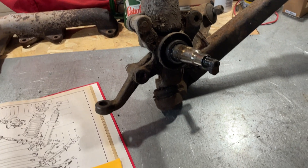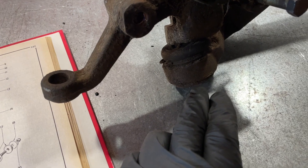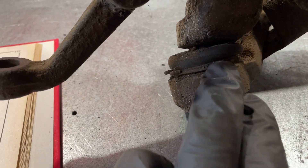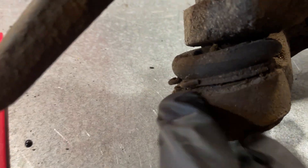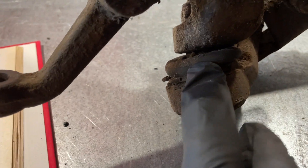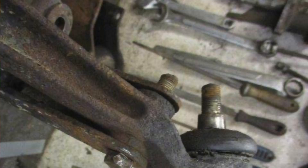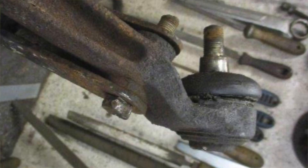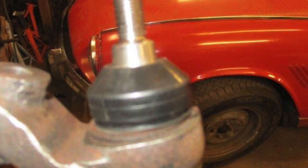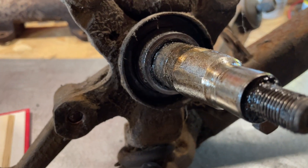The issue with ours was actually down at the bottom. Looking at the ball joint assembly — this example isn't too bad; you can see it moves around on a ball joint. Ours was leaking quite a lot. It's held by a little circlip round on top of the rubber, with packed grease inside. We had quite a bit of leaking grease. So whilst the car was in, I thought I'd get that replaced, which the mechanic duly did using presses that I don't have.